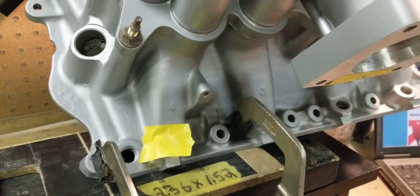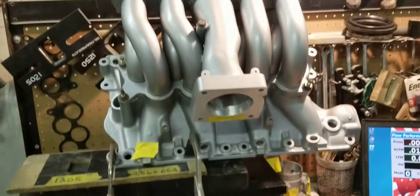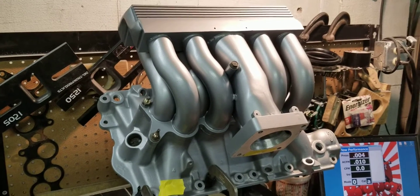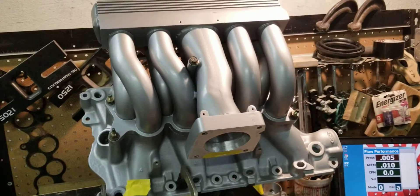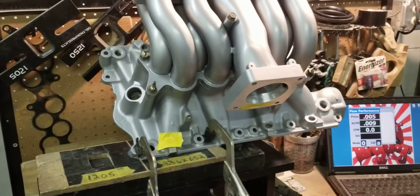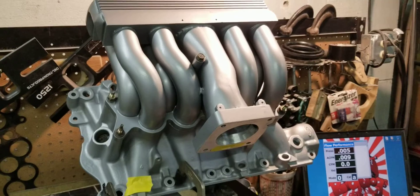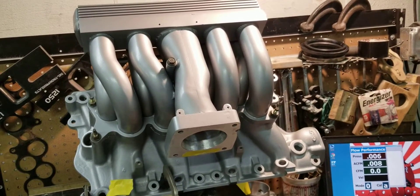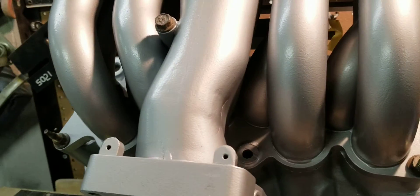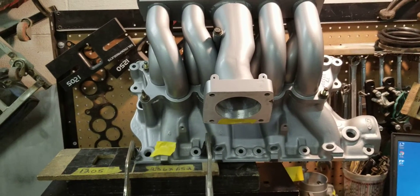The number 4 right here — that's pretty good for this manifold. Actually, it's excellent for this manifold. So many people out there spread these rumors around the internet saying you can't port the tubular, you can't do this, you can't do that. Stop it. Please stop it, because for the newcomers, you're confusing these individuals. You can port anything. You can port stock manifolds, you can port aftermarket manifolds, you can fabricate manifolds and port those too. There really aren't any limitations on improving a manifold.